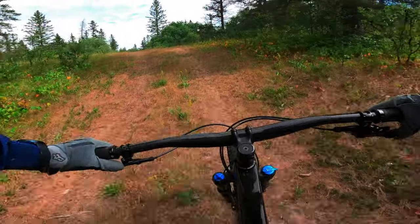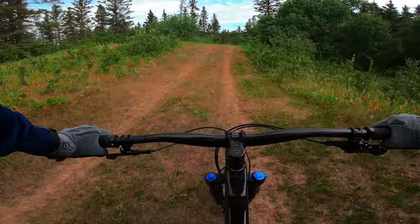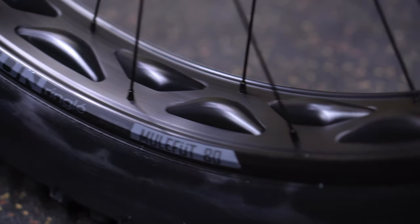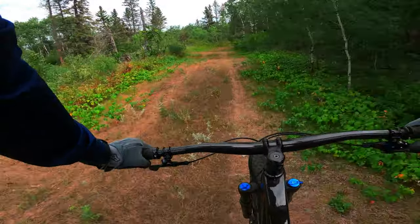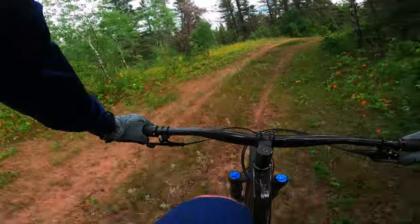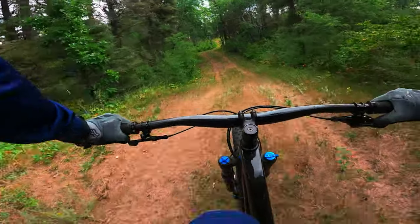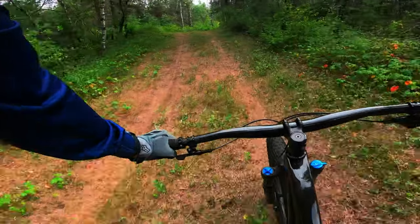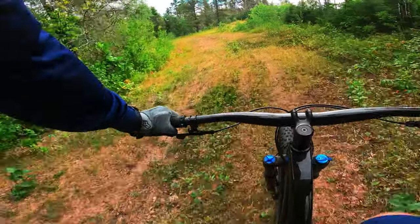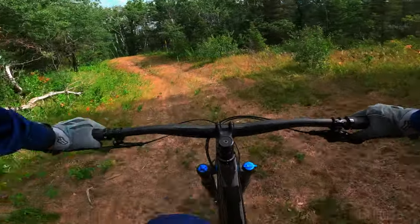It comes with the Sunringle Mule Foot wheels, which seem to be the go-to wheel choice for pretty much every Trek Farley and many other brands looking for a really good set of fat bike wheels. They work really well and have a 108-tooth rapid drive hub, so engagement from the pedal stroke to the wheel is really fast — there's none of that play, which makes a noticeable difference even if you might not always notice it right away.